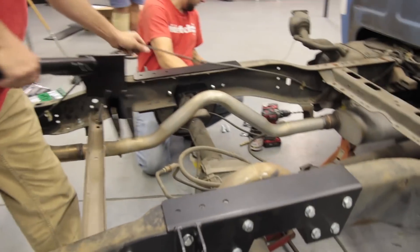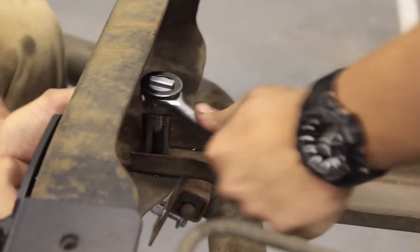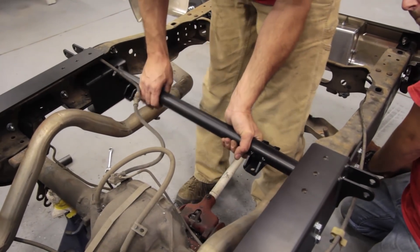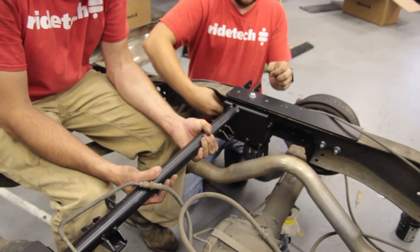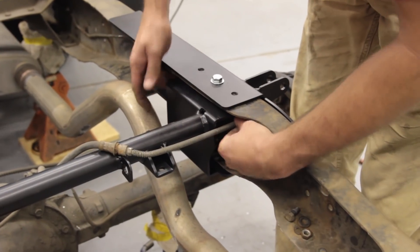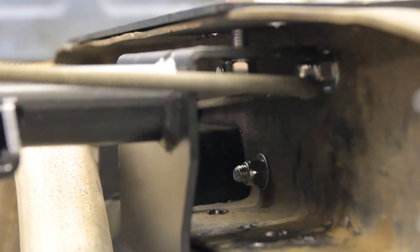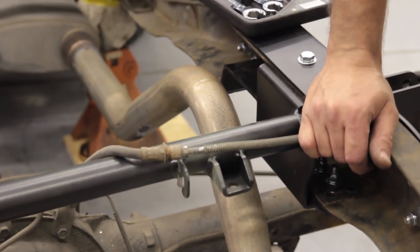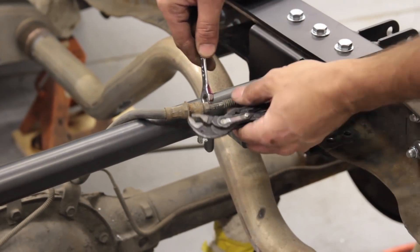After the C-notches have been installed, the upper crossmember can be installed. It's located using the three holes at the top of the C-notch. Depending on your exhaust, the spare tire mount may have to be repositioned temporarily to get the crossmember in. As you put the crossmember in, there are several layers of material and a lot going on — it'd be easy to get the brake line pinched behind something, so make sure it's out of the way when tightening the crossmember bolts. We ended up with the rubber line on top of the crossmember when it needs to be on the bottom side, so we took the brake line apart to fix that.